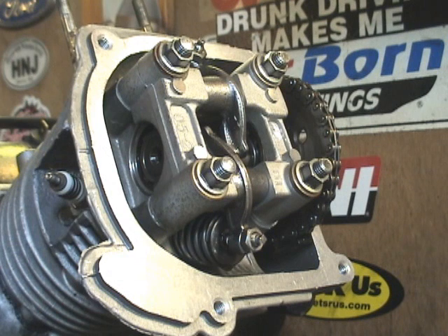I'm going to show you how to adjust the exhaust valve for this video. The procedure for both intake and exhaust is basically the same, but you may use different settings. For example, I use three thousandths of an inch (.003) on the intake and four thousandths of an inch on the exhaust. Some people use three thousandths for both, four thousandths for both, or two thousandths for both. Any of those, honestly, should work fine.